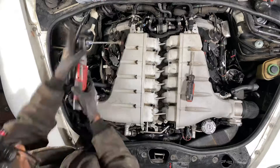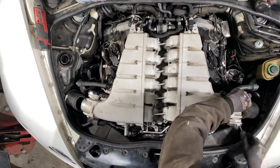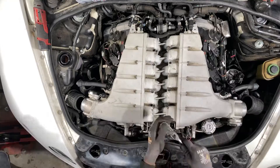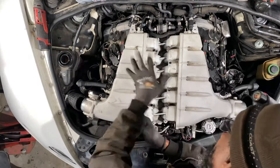This is the charge air hose going into the engine from the turbocharger, so we're dropping them off on both sides. This is a vacuum hard line that I'm taking off, which is bolted to the side of the intake manifold as well, so we get that off.